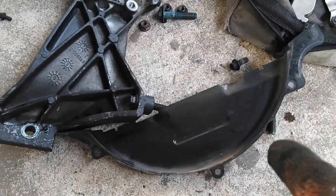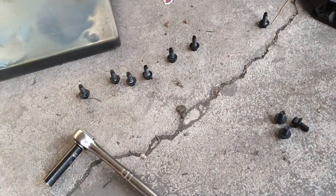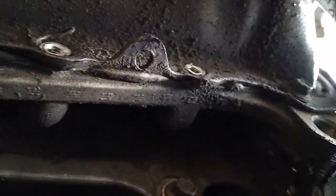We got a bracket, we got a lower flywheel cover, braces, and then I got about that many of the bolts out of it already. There are a few bolts left to deal with — some on the front, some on the back. When I tell you they overbuilt this car, I mean it folks. They definitely didn't want that to fall apart. Let's bolt the exhaust to a bracket with six 13-millimeter headed bolts, then put that over the oil pan, then put a cover over that — so you'll miss those two bolts if you ain't expecting it. If you get one of these, it certainly won't fall apart out from under you. It may wear out, but not fall apart.